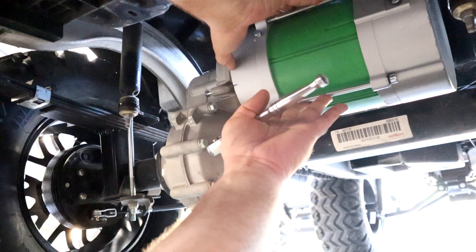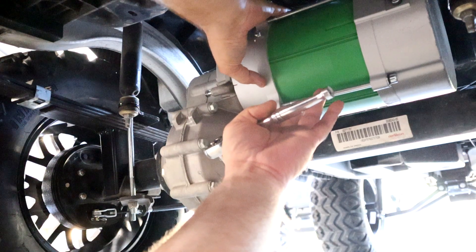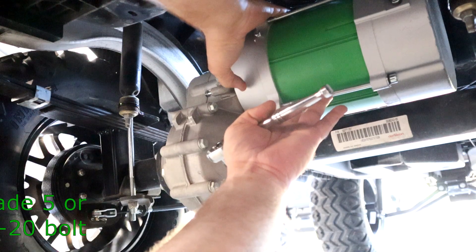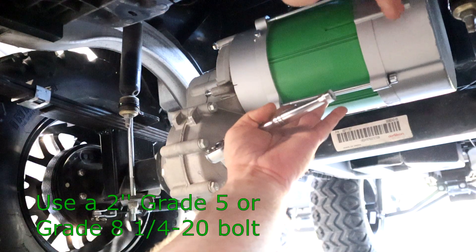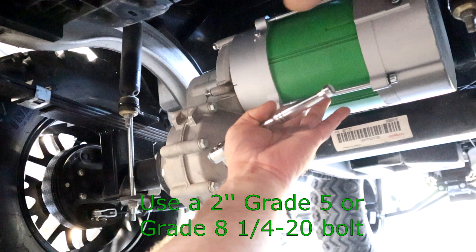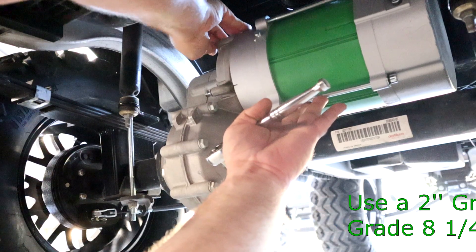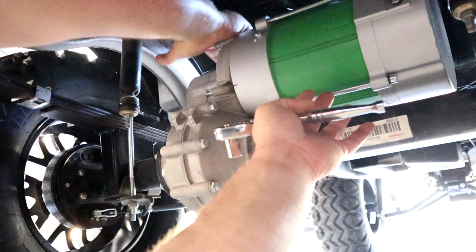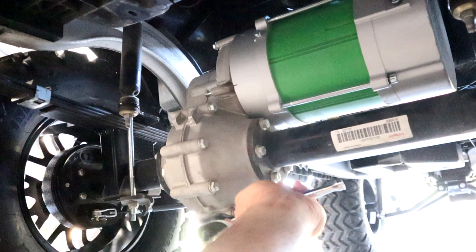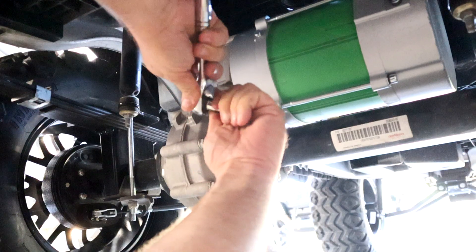We have our motor in place, pushed all the way against the flange, and I've put my 7/16 bolts back in. I had to reuse my hardware from the stock motor because the bolts in my Navitas kit were not long enough. When you put this motor in, don't use your screws to suck your motor in — you want to get your motor up as tight as you can, put your screws in, and most of the time you can get these almost all the way in by hand. You have a bolt here, one on top, one on the bottom, and then a bigger bolt. Go ahead and tighten them down.